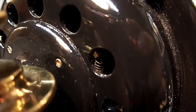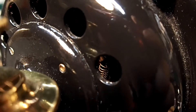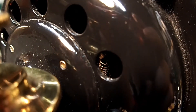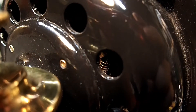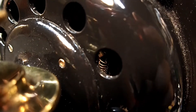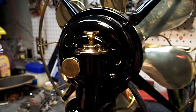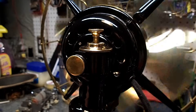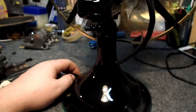When I first turned this fan on, you might have been able to hear a clicking sound. That is the mechanical switch inside — you can see the spring of it. When the fan is running at a low RPM, it will engage what I call the starter winding and give the fan more power to get the blades moving. As soon as it speeds up, that clicking stops as that switch opens, and then it's just running off the primary windings of the motor. So if you listen as I start this motor, you should hear that mechanical switch clicking as it turns on, and once it reaches speed it shuts off.